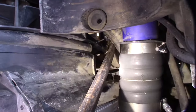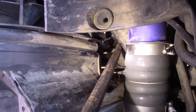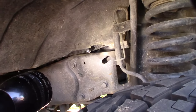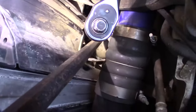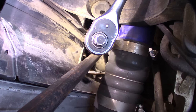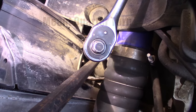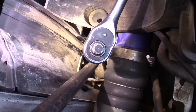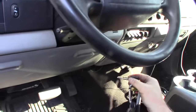It is very difficult to get in there without taking the whole radiator out, so I put a crowbar in to give a little extra space on the radiator hose. I have the wrench coming from this side right under the shroud. I'm eyeballing the nut, backing off on the allen about a quarter turn, and then tightening the lock nut again. That should bring it in a quarter turn.